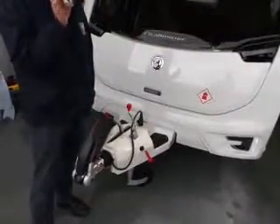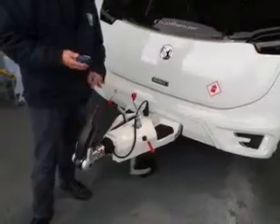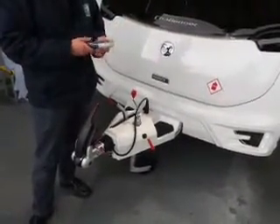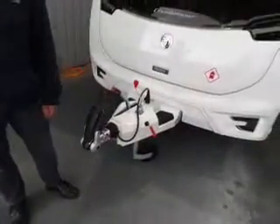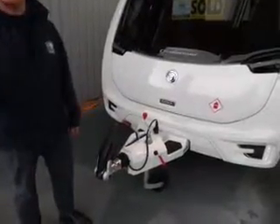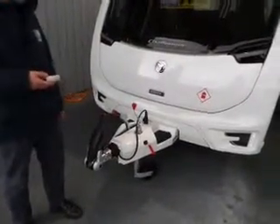When you put the caravan back onto the car, make sure the motor mover is off the wheel first — otherwise you'll end up shredding tyres and damaging the gearbox. Also, do not leave the handset on the caravan. If you drive off it'll disappear and it's expensive to replace, and it could damage your car roof. Best thing is to put it on the car seat so you can see it and it reminds you.